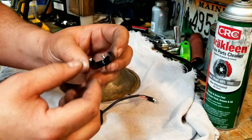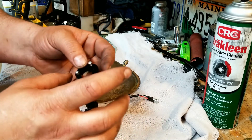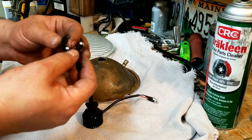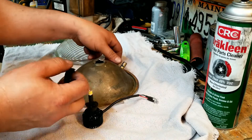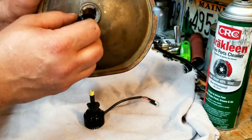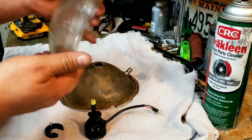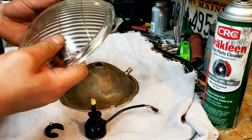What I did was machine up this little horseshoe collar — I can make a drawing of it if anybody wants it. I think it's quarter inch; I forget the OD and ID. Very simple — just turned it in a lathe, bored a hole, then put it in a Bridgeport and machined up this groove. You don't need a lathe and a Bridgeport — you could do it with a couple of washers and a Dremel. Then I drilled and tapped a couple of number 4-40 holes. I picked these reflectors up off eBay — new old stock originals, I paid about a hundred bucks for the set.